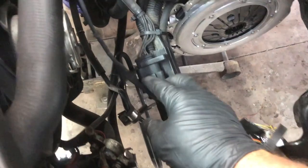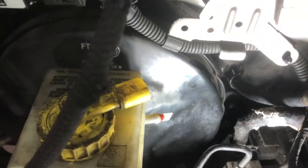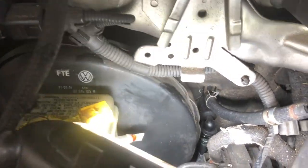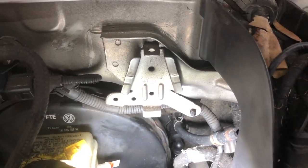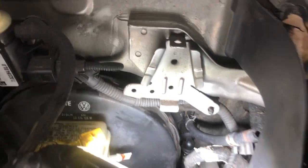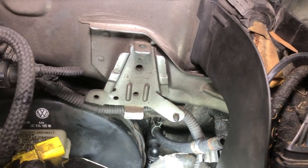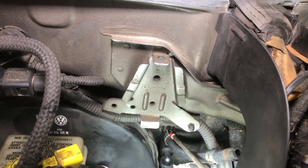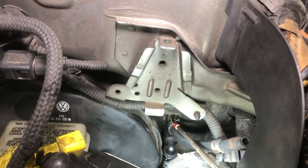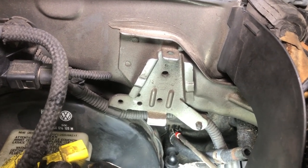We went through wiring extensively, so my wiring is all ready. And down in here we have the lines and the pedal. So there you can see the end of the master cylinder for the clutch, the clutch master cylinder. There are 2 lines from it. That top line is the supply line right here. Getting that clamp on can be challenging. I actually use a long needle nose pliers on the clamp and then a screwdriver on the other side and work it back down on.